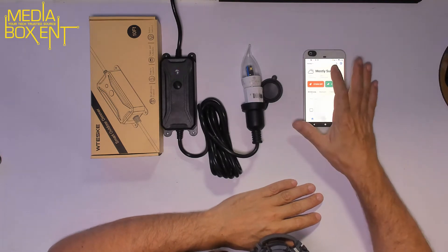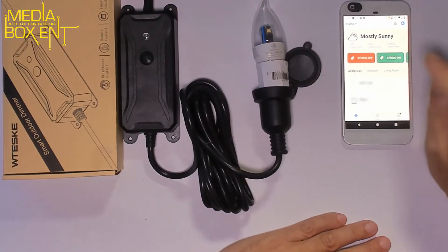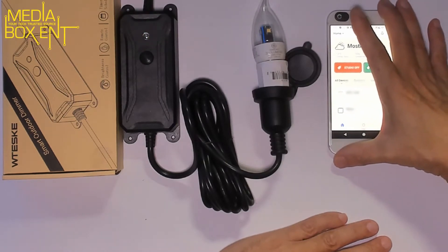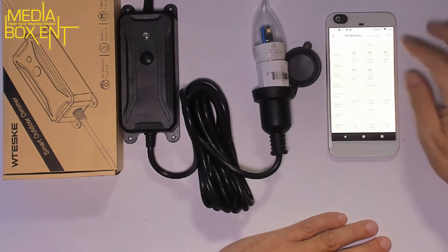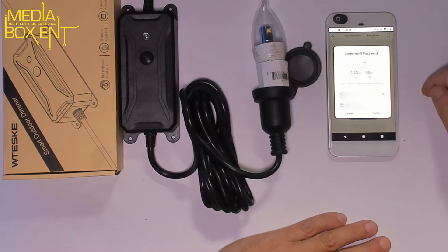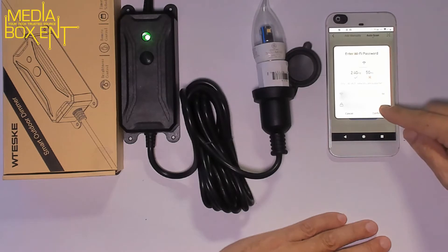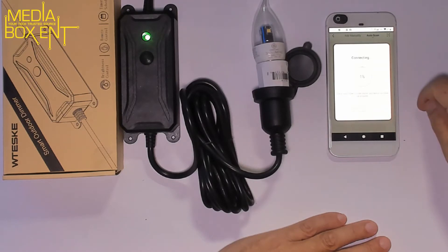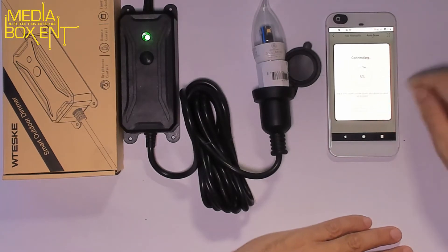Here's the way we're going to do it: just download SmartLife, either for iOS or Android. It's blinking. Make sure you are connected to a 2.4 GHz network — at least for the installation only, then you can switch back to 5 GHz. If you have data on, turn the data off. Click the plus. Automatically detected — you can do an auto scan, and it will show up. I'm going to click here, then next. Confirm your 2.4 GHz network, enter the password of your network, and click OK. You see it stopped blinking — it already detected.